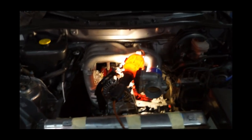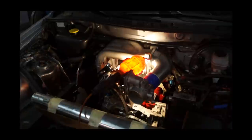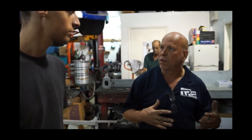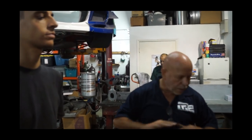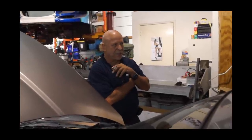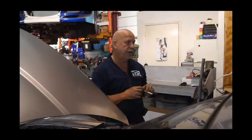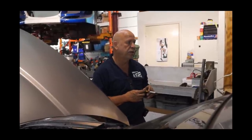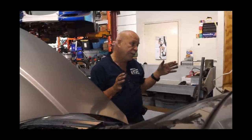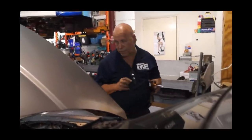Keep it simple. Simple and clean. The only thing that actually mates together without having to reinvent the wheel is the transmission. Everything else has to be custom on the turbo race car build. I came up with this layout for my third generation because I wanted a massive intercooler and for the three-rotor that gets hot, I want the radiator getting as much impact air as possible. And then on top of that, I have a supercharger where the plumbing to the intercooler is complex.